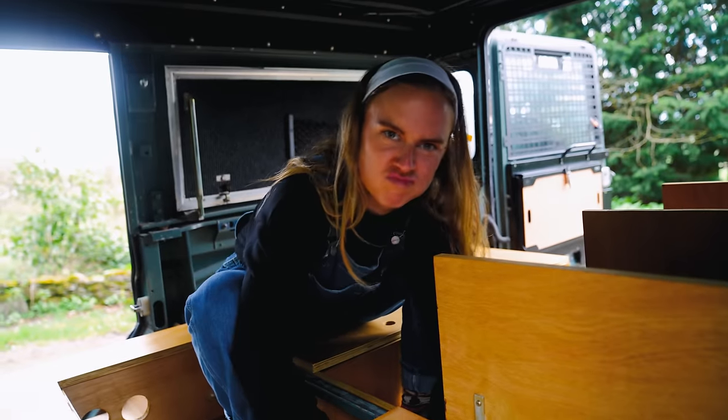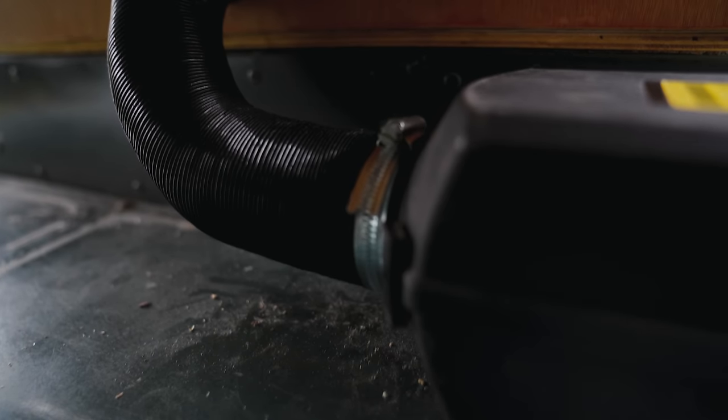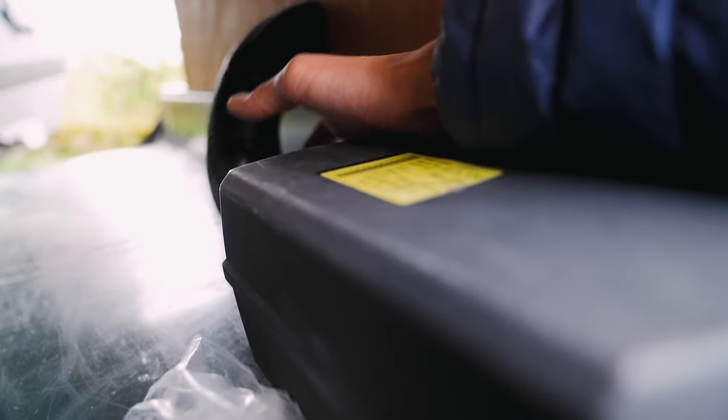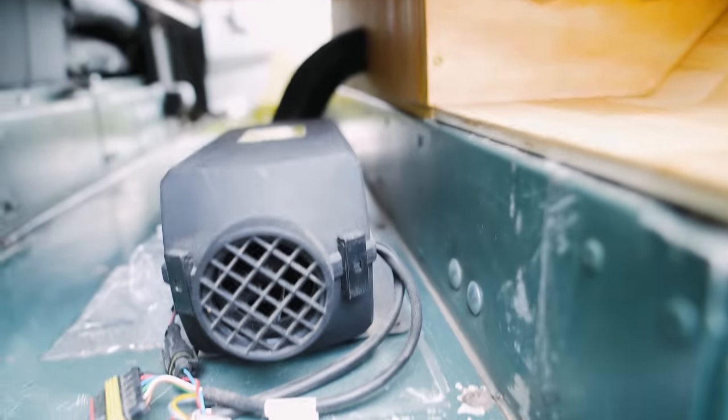Oh my god, this is... Of course, we got the pipe coming up the hole down here. A Jubilee clip on there to hold it in. Feels pretty secure, and we're probably eventually going to try and fill the capping on that side that goes behind the pipe, so when we're putting stuff into the car, hopefully nothing should bash it around. So yeah, diesel heater down here, then the pipe runs through here, and we've got a little protective frame there to go around it, and it sticks out there, and we've got a little capping end piece somewhere as well.